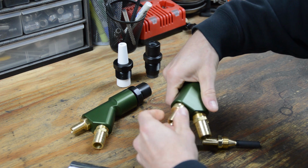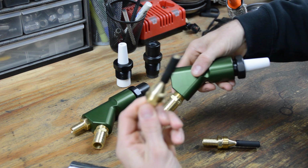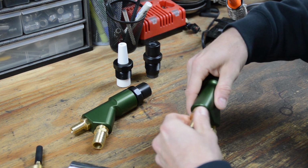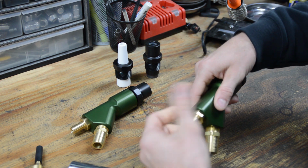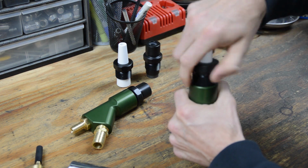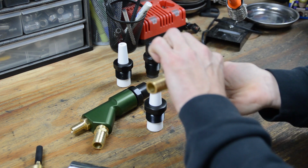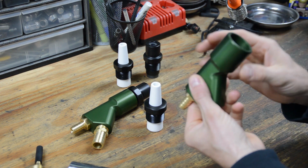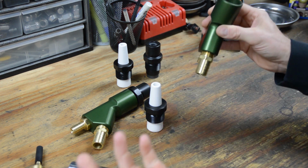Okay, so you take the air jet out. This is the 10 horse air jet. This is a larger air jet, so you have the 15 horse air jet in there now. I'll go ahead and tighten that, and then remove this nozzle nut. So that's the 10 horse. There's an O-ring in here. The O-ring doesn't want to come out, that's fine. There's an O-ring in here, and that is the same.